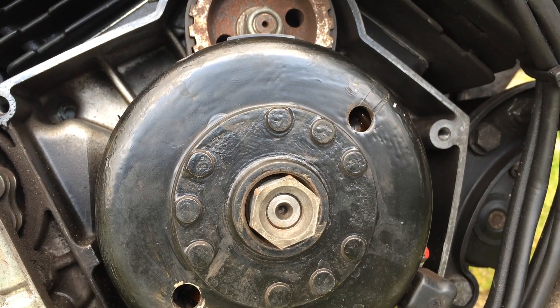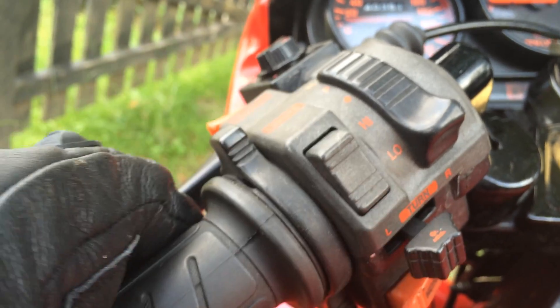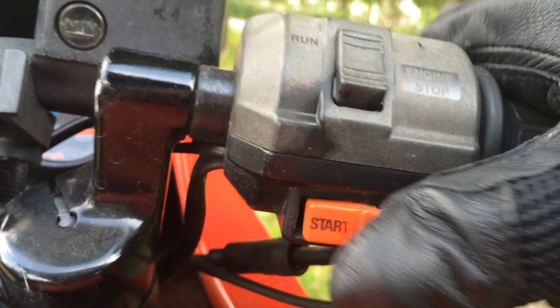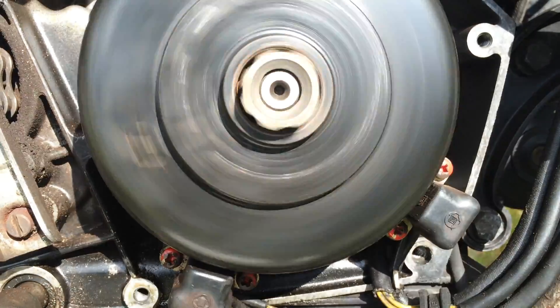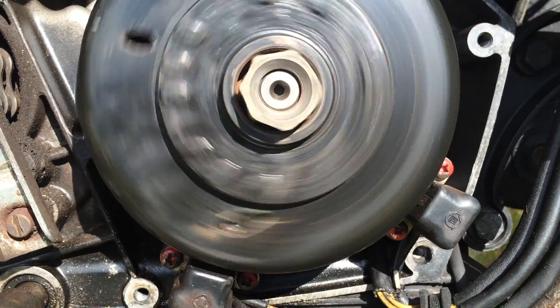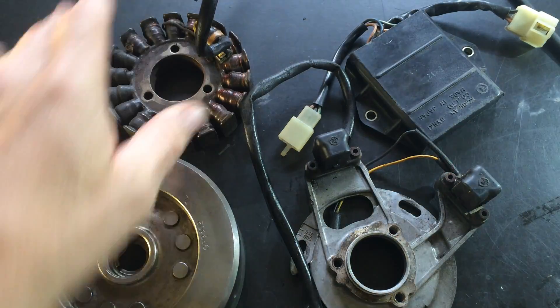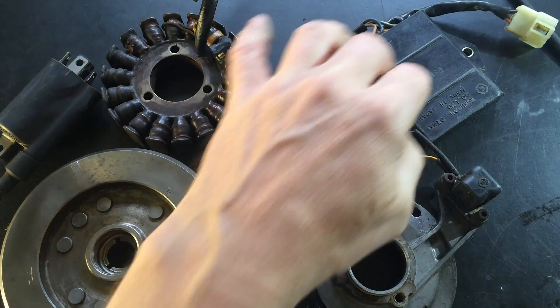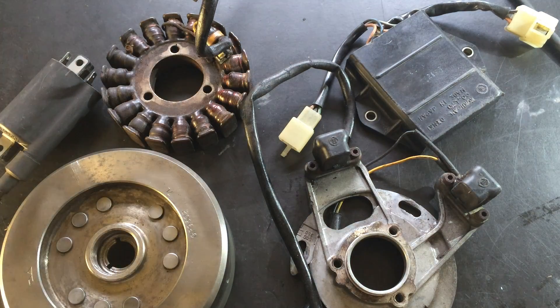There are numerous reasons why the Kokusan system is better than the old ones. The only downside is the often stated argument that you're battery dependent. With the quality of batteries these days and the availability, you can get a battery almost everywhere — I don't think it's a problem. You have a much more powerful generator with a stronger magnetic field. A CDI unit that is more reliable, and it's separated from the ignition coil, so you don't have any heat issues or interference that will ruin your CDI unit. The ignition coils are way bigger than the old ones, so you have more power to the spark plug.